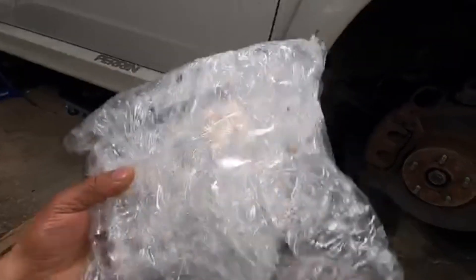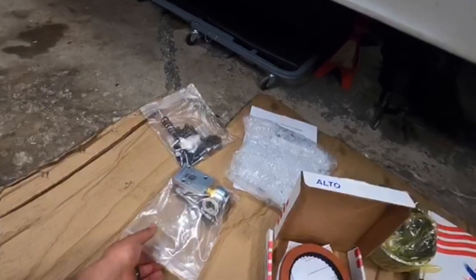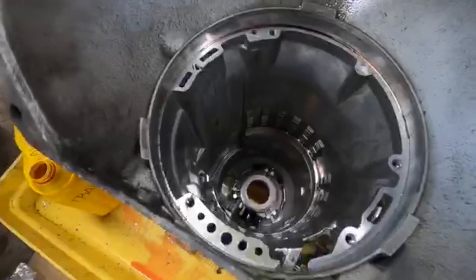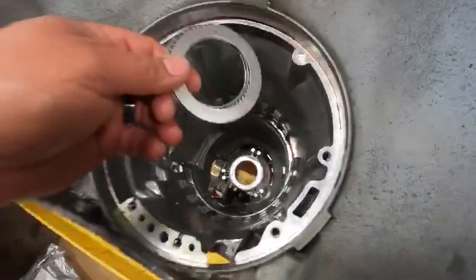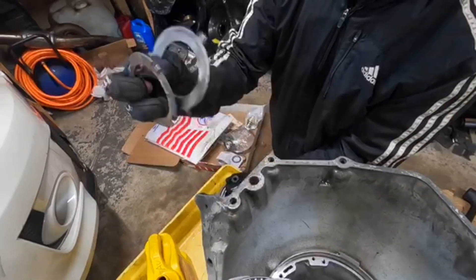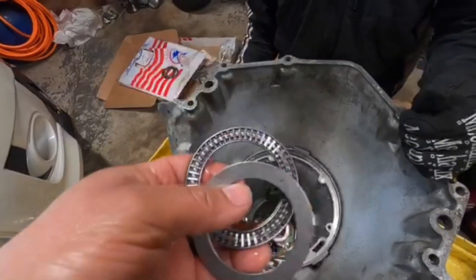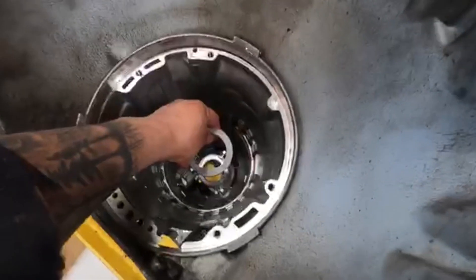This valve body is from TSI. On the bottom, we just put in the Royal rollerized output bearing — a roller-style bearing which will be a little more effective than the original washer-style bearing. It should be a little bit easier on the output. You also have a couple of shims on there to make sure you have the same spacing and play.